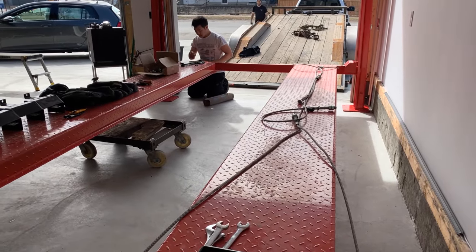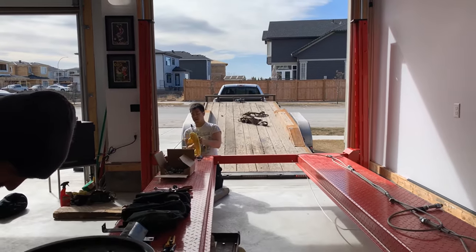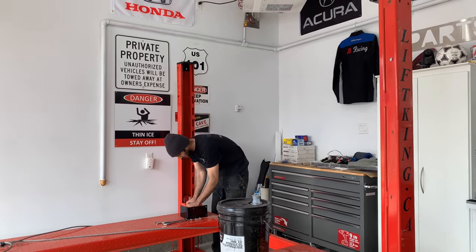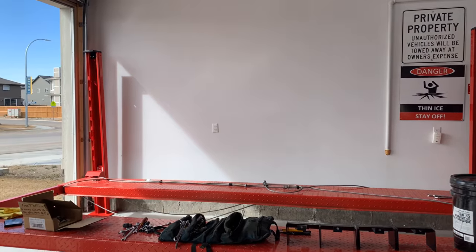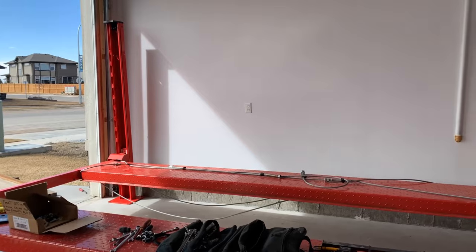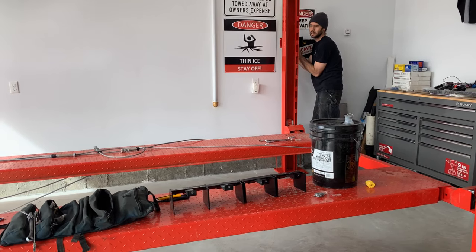At some point I want to get the bridge jack — that's probably the next item. That way I'll be able to work on suspensions and tires. The bridge jack sits on top and works in combination with the jack tray. You slide the jack under the vehicle once the hoist is up, lift the back end, set two jack stands in the tray, then come back and pick up the front — all four tires in the air in two minutes. You can also still jack up the vehicle with the jack tray that's provided.